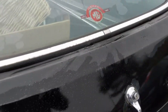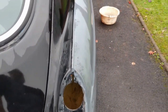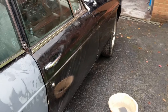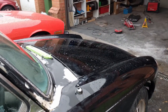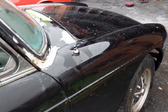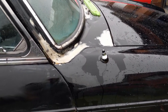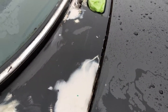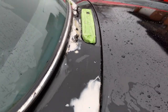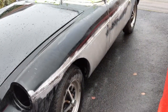This is just overspray so everything will get a 600 grit sand. I've started along the front here. I'm not going to do the front wing or the bonnet because they've both been painted already, although I did manage to create some scratches in the front wing. So we'll allow a bit of overpaint on both of those, just as overspray rather than anything else.